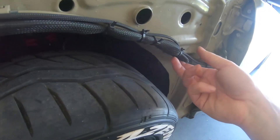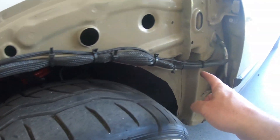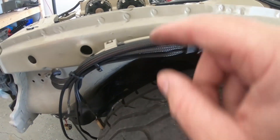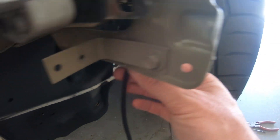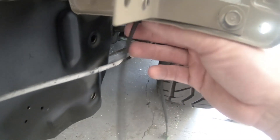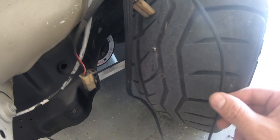I know some people may think 'oh it's zip ties, it's a Honda' — whatever the case is. I don't have any intention right now to run hood latches, so this hood cable is not going anywhere — it's a stable brace. Honestly you don't see it, and it's nice and snug up against there. The big loom is for all the headlights and the corner lights — this other single wire running through here now is the fog light. As you can see it's going to come down here and route across. What I'm going to do is open up this hole right here to three-eighths and put a little clamp there so I can route the wire and it doesn't have the potential of dangling and potentially hitting the wheel.